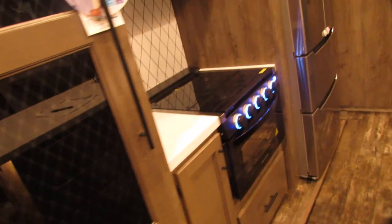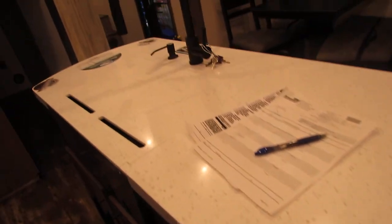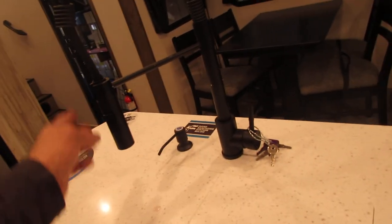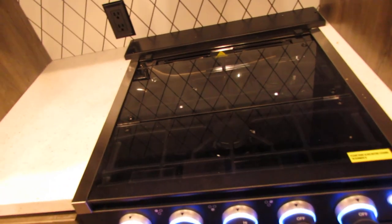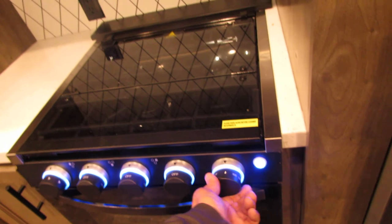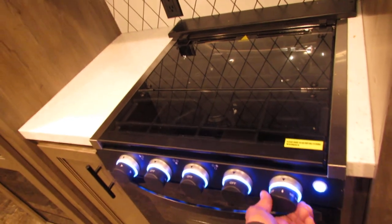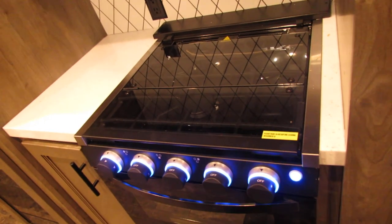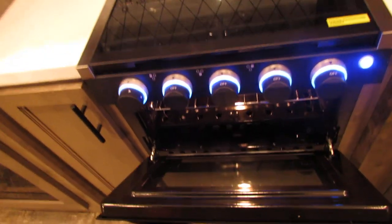Big pantry. Nice, big, spacious cupboards. Manuals and remotes — everything's in the drawer on this unit. Got the nice covers. Expensive faucet, hand sanitizer unit, and keys hanging there. You have a light here. The trick to the stove: if you want to do stovetop, you turn it on and hit your sparker. If you're going to do the oven, you actually have to hold the button in at the same time as you spark it. Just hold it in — you can see it. I use this as the mirror, so I hope that's helpful for you to light the oven.